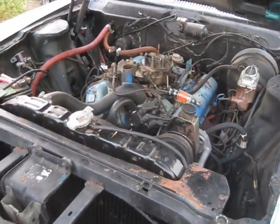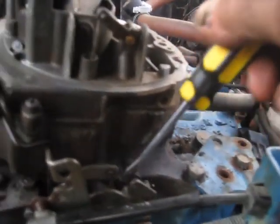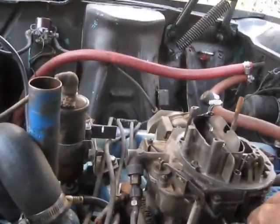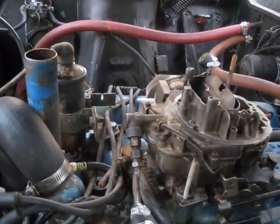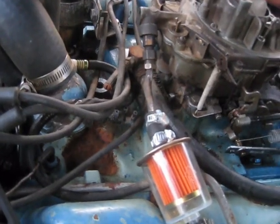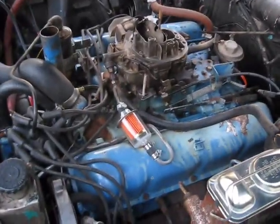It fired up — good. Got the idle way too high. I couldn't quite get it to run the mixture screw down; I know I'm about a half turn off. I'm not leaking anywhere. I've got my vacuum vents off of it, so that might make a little difference. I hear a lifter ticking, but I think there's some Rislone or something I'll fix that with.